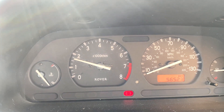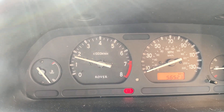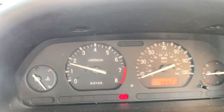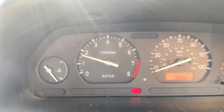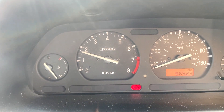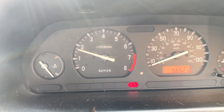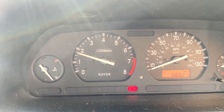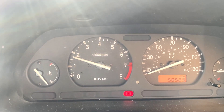Just one of the symptoms is idling high when stationary. Another thing is fuel consumption, which is usually a lot worse than it should be. When you start it up it should be idling around 1100 RPM, and then when it warms up it should drop to about 800 RPM, just below the one. But in this case it doesn't, and this is what we have to put up with.